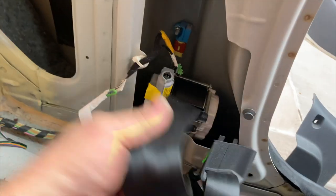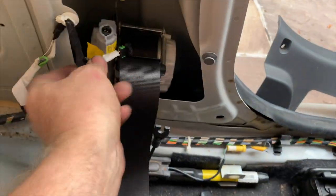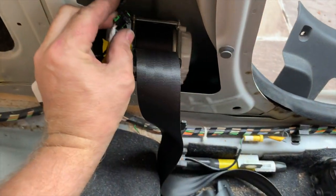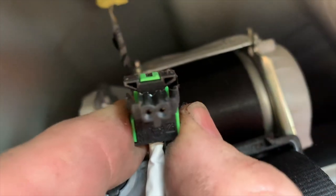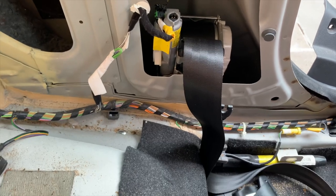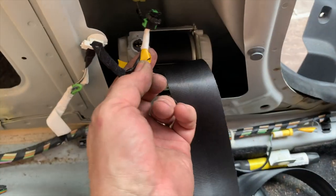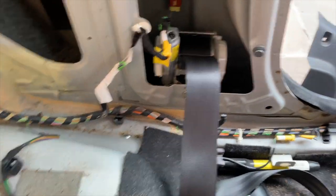You've got the seatbelt reel, which is for some bizarre reason very noisy. This seatbelt, I've just noticed, has been repaired somehow. Normally if you repair a seatbelt you see those holes at the end there — you put a resistor in there. I had no warning lights up on this car but there's no resistor in there. So someone has bodged that — I don't know how they're getting that to work and not throw up an airbag light. That's really weird. Because that needs to be plugged into there and it normally is — somehow they've managed to get round it.